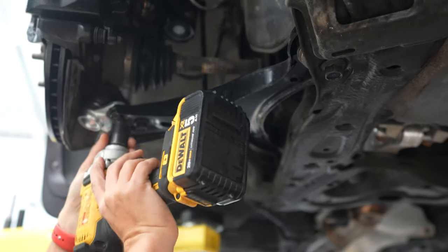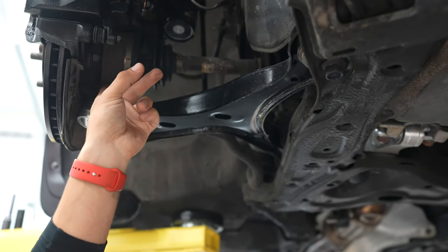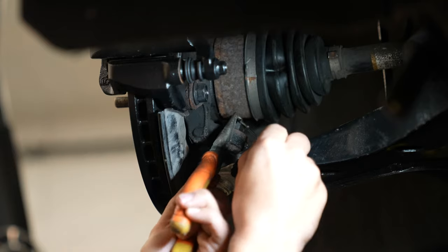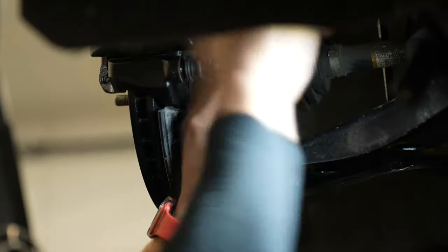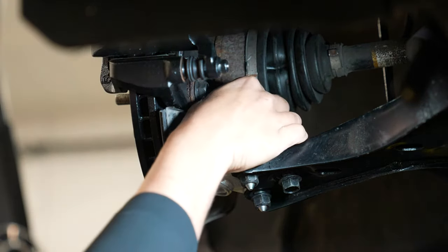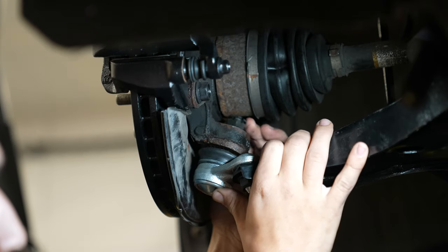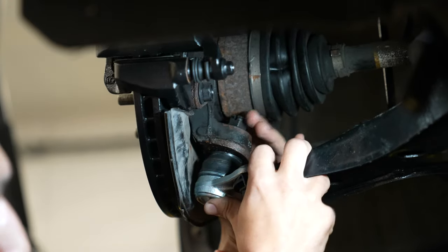To install this little billet piece, using a 17mm socket, take off the two nuts and the one bolt found here. Loosen them up first but don't take them out yet — we need to make sure we can remove the upper section of the ball joint first. Using a pick tool or needle nose pliers, remove the cotter pin going through the ball joint and set it aside, as we'll need to reuse it during reassembly. Then use a 19mm wrench to crack the castle nut loose and begin to unthread it from the ball joint. Using a pry bar or pickle fork, separate the ball joint from the knuckle. Keeping the castle nut slightly threaded on the threads prevents the control arm from swinging down. If yours is a real pain, you might need a proper tool to separate it — I'll link a helpful kit in the description box.